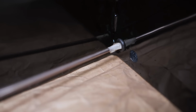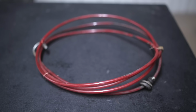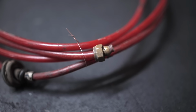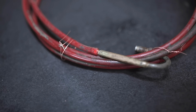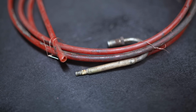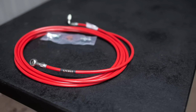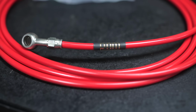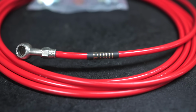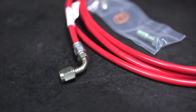These parts from P&M are full of nice little surprises. This is the original red plastic clutch hose. Yes, plastic. When this pipe would heat up in the engine bay, it would expand and the driver wouldn't be able to select a gear. All the force was being lost, like a homemade pipe bead tool. Good aftermarket clutch pipes for an Esprit all have braided steel outers to combat the heat-induced problem, but the P&M one has a bright red coating on it so that it tips the hat to the original. It's a lovely touch, and it's given my chassis a splash of colour that makes me swing.